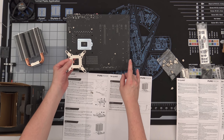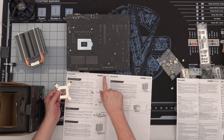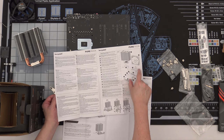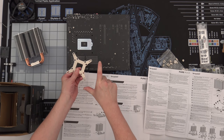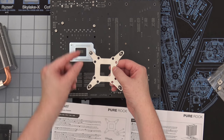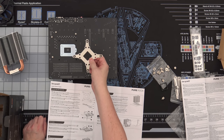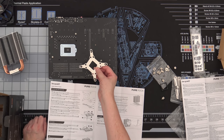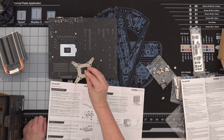Just to cut in here — I was preparing the backplate installation for the cooler. I want to talk briefly about installing these custom coolers. You really need to take your time, read the instructions, measure twice and even three times. I now have the backplate set up with posts mounted through with O-rings. Honestly this was not easy and I ended up having to redo it. Be Quiet does have better mounting systems on their larger coolers — the Dark Rock Pro 4 was very easy to install; this Pure Rock needs a better mounting system.